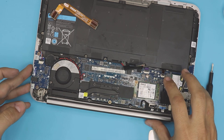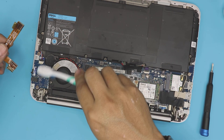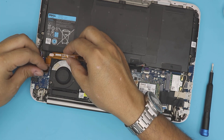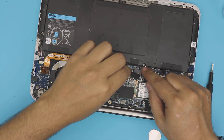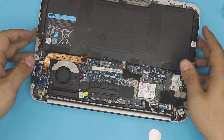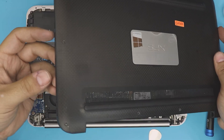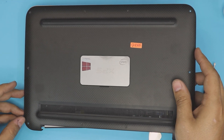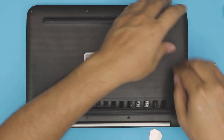Now the heat sink is in, nice and clean. Grab the bridge cable, make sure the contacts are clean and there's no dust, then bring it straight down and snap it in place. Grab the battery connector, bring it straight down, and push it inside the jack — make sure it's all the way in. For the top cover, this is very important: make sure the power-on switch goes through the hole in the cover, otherwise you'll break it. Set it down and push all the corners to hit those clicks.